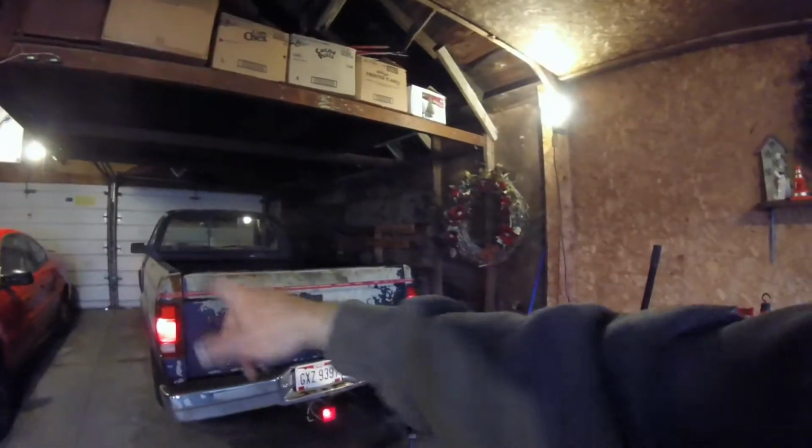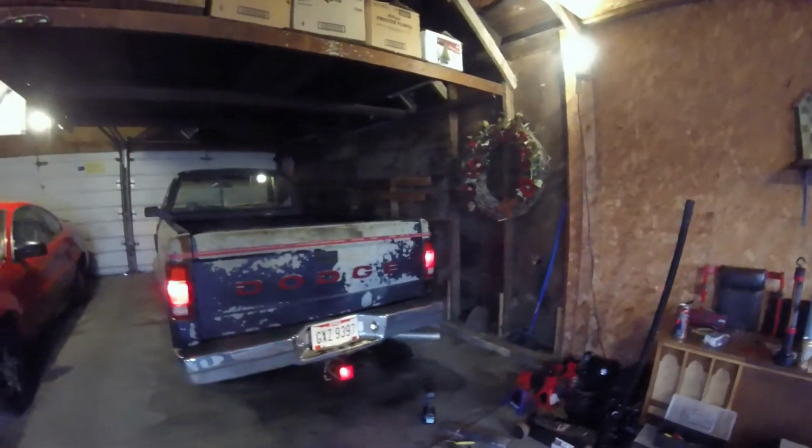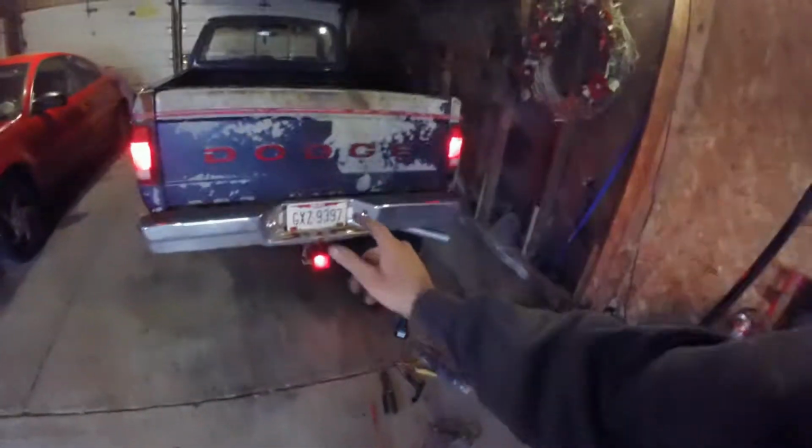So in the future I'm just going to go get entirely new taillight harnesses for either side and new taillights, or junkyard taillights probably. Put those in so I have the new plastic style taillights, and I can use the better 1157 bulbs and maybe put LEDs in it at some point, because I have an LED blinker in the truck now that I can run LEDs on, so I may just convert it to LEDs. But I want to have multiple extra turn signals and brake lights.